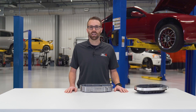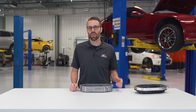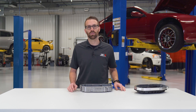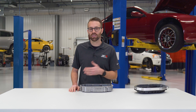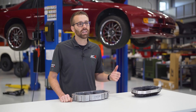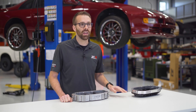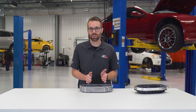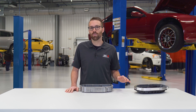I saved the best for last — let's talk about the active baffles. Baffling in an oil pan serves the purpose of making sure that the oil pump pickup tube stays constantly supplied with fresh oil. During everyday driving it's really not an issue, but if you're on track and you're in the middle of a turn, the oil in the pan is all going to slosh to one side. This still isn't an issue unless the oil slosh is so far over that the oil pump pickup tube starts to suck in air. Sucking in air means that your oil pressure will drop until the pump can get more oil. This can lead to oil starvation, which is a very, very bad thing and can relatively quickly lead to engine failure. Passive baffles generally just look like walls that stand in the way of the oil slosh and keep oil closer to the pickup tube. Passive baffling usually works fairly well depending on the design, but it's not the best. The best solution is active baffling.